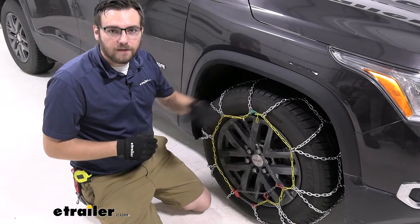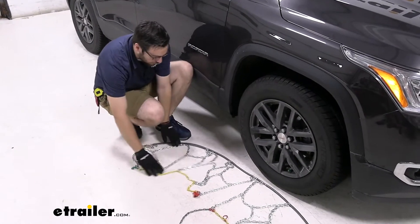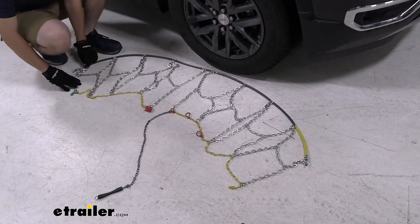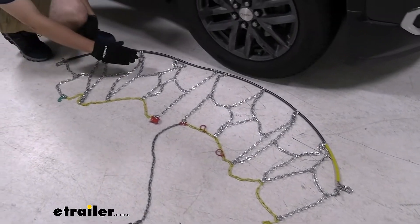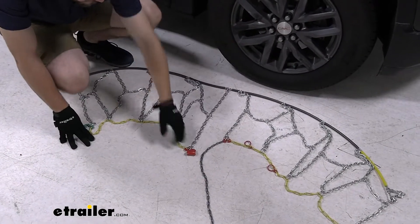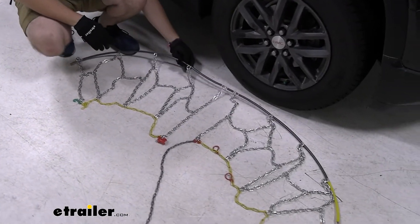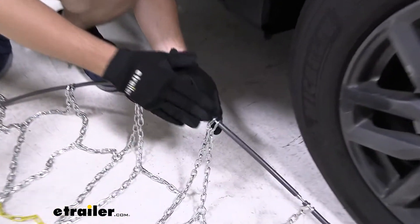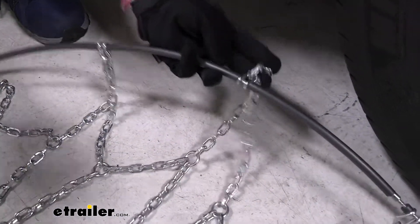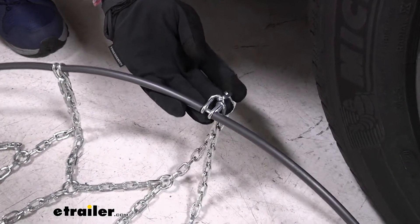The installation isn't going to take too much time at all. For our first part of installation, we're going to lay out all of our chains here. We don't want any kinks, links, or binds in our chain. A lot of times what ends up happening is your little plastic rod finds itself through one of these chains — usually all it takes is to undo that. We also want to have our smooth side facing towards us as we bring this around our wheel and back up on top of it, making sure that hard point of contact isn't poking into the wheel or tire.